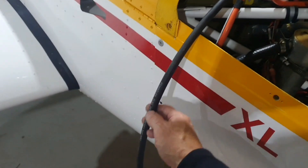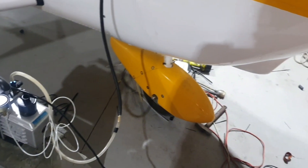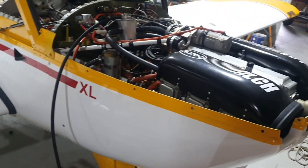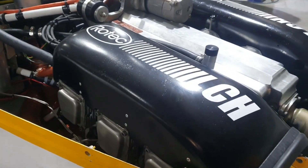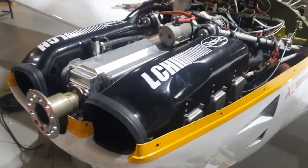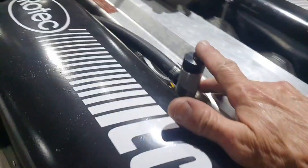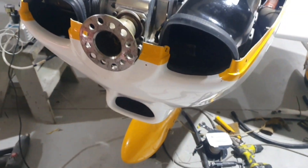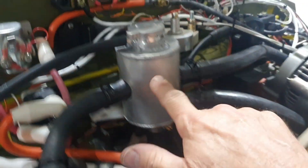I'll clamp the line with a G-clamp and then drop it into the coolant bucket — a measured amount of coolant, as these things take about three and a half to four litres. Then I'll see how much it sucks in. Hopefully that'll fix the bleeding issues and make bleeding a doddle — my customer said it worked perfectly. I'd imagine my vacuum pump will pull better than a venturi but it should work equally as well. Once the coolant's in we'll top up some oil, push it outside and fire it up.